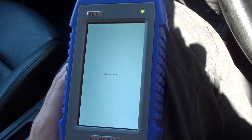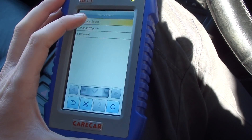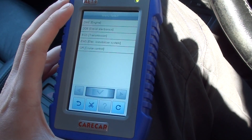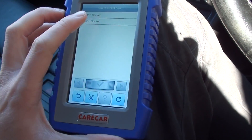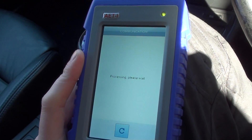It's just connecting with the BMW ECU system. I'm manually selecting the vehicle — it's a 3 Series, E46. I'm going to select the drive, then select the DME which is the engine. It's a 16-pin — we've got it plugged into the 16-pin diagnostic port under the dashboard. This sometimes takes about 30 seconds or so to actually connect.